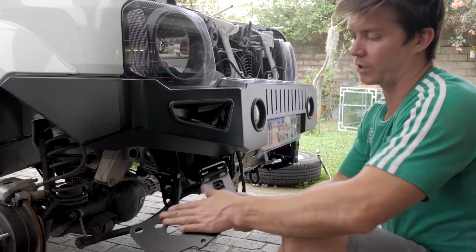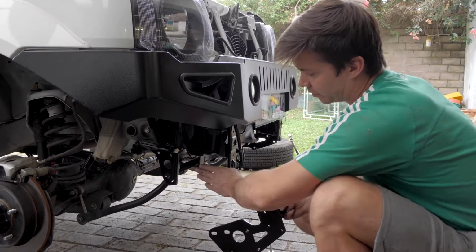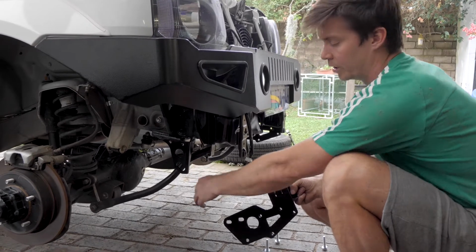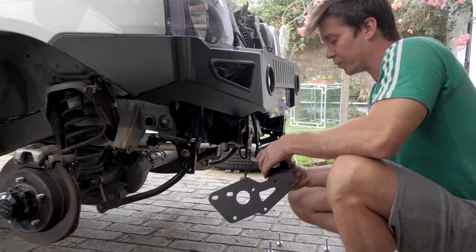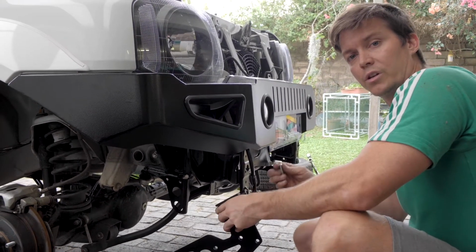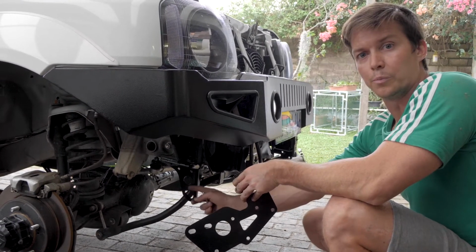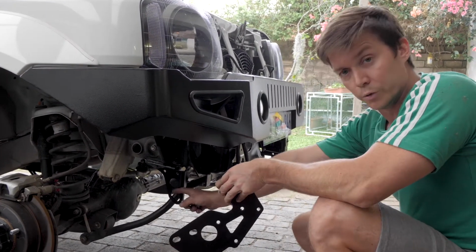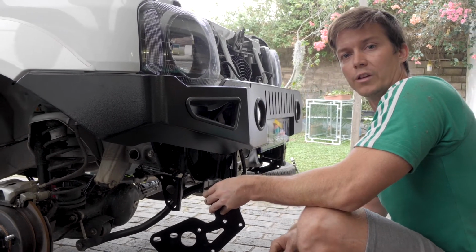Okay, here we've got the driver side bracket. It's straight across this face as it lines up nicely with this recovery point. That's this existing recovery point. So we're going to do the same principle as we did on the passenger side. Line this up first, get the bolts in, make sure it's nice and loose so we can find these points here. We'll get the screws in these holes, and then we can start lining everything up and tightening.